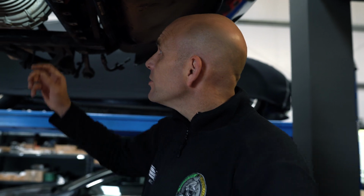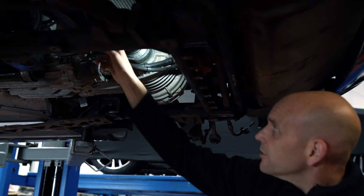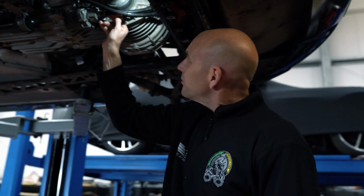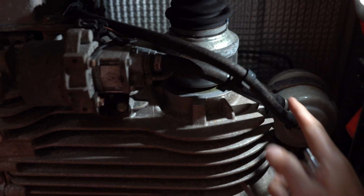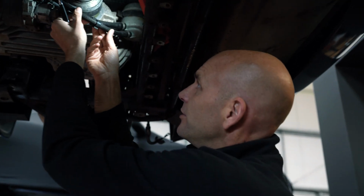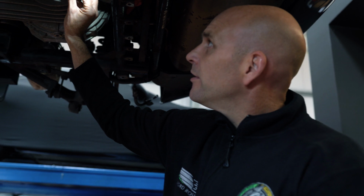So these are the pipes I'm talking about. Here's the reservoir, this is the feed pipe to the pump, and then the return pipe, both operating under low pressure. And if you see the cracking or perishing that that pipe exhibits, and at the top joint there, and starting to a lesser extent some witness marks of age deterioration there, that's the sort of problem that we're talking about.